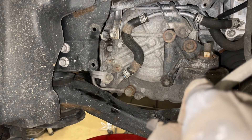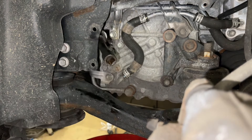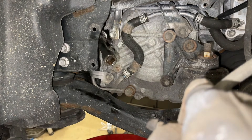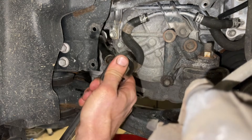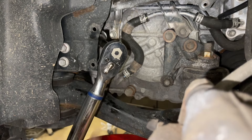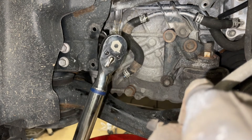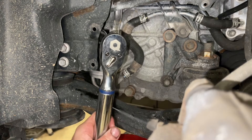There is a flaw to this: I've got a U-joint in here, and that will change the torque spec — I will not be delivering the full torque that the wrench says it's delivering. But this is how we're going to do it because there's not really another choice. I've got my torque wrench set to 29 foot-pounds, and we'll torque it down.